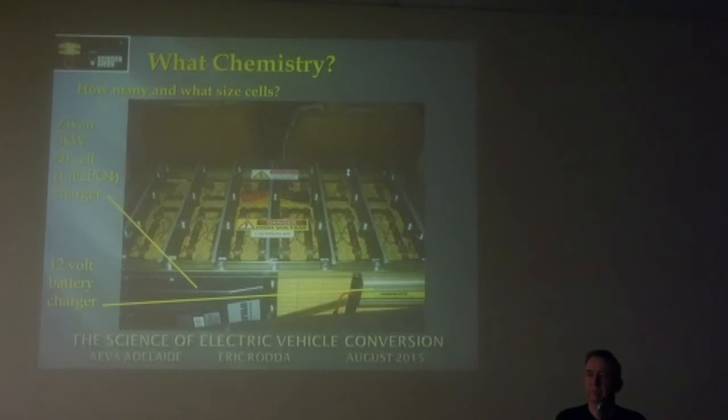I'm not sure whether my brushes might not have been worn in from new. Some of the motors come with the brushes just square, and you have to run them in, to wear them in basically. With my new brushes, I put the motor on a 12 volt battery and ran it continuously for 270 hours, and gradually wore the brushes in. Even though I got the brushes made in Queensland and told them the diameter of the commutator, the brushes don't sit squarely against the commutator in their little holders, so it still had to wear a little bit away to make it flush with the commutator. It took 270 hours, the equivalent of over 9,000 kilometres at 35 k's an hour, continuous.